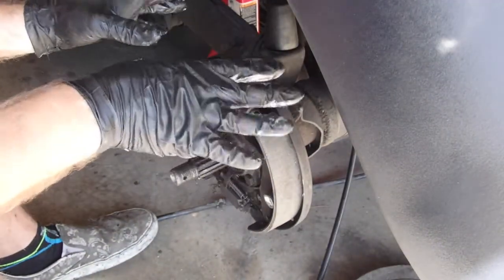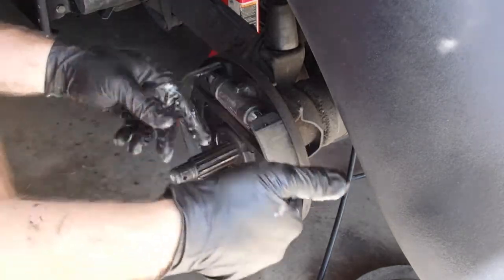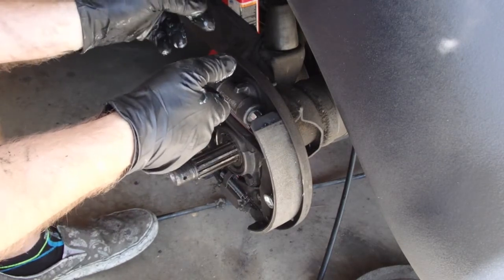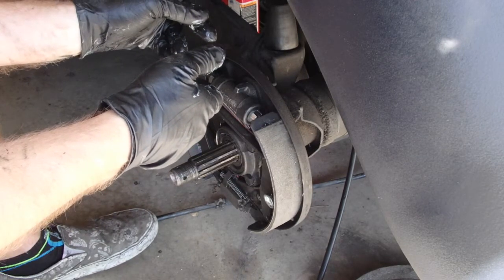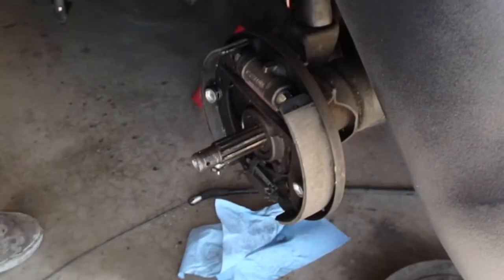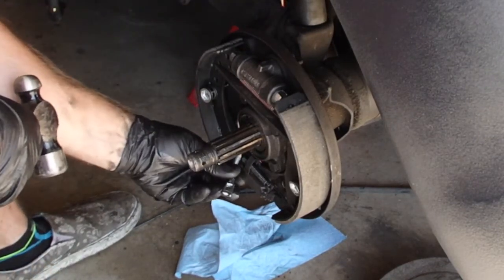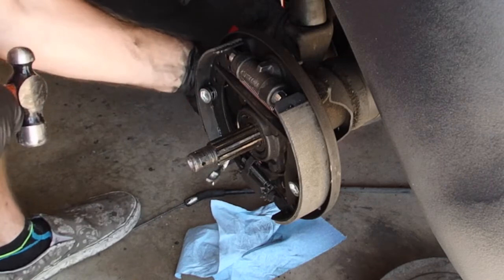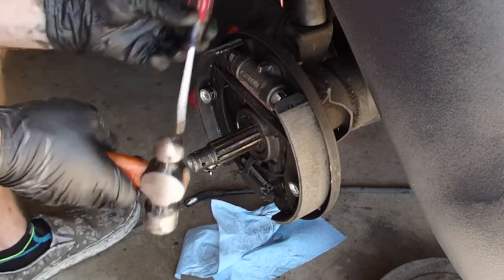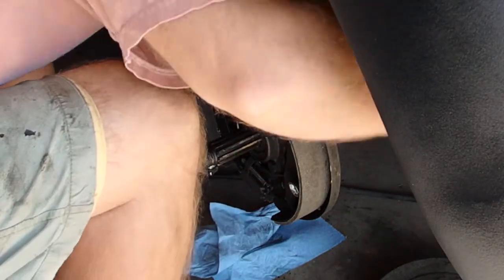You do not want to shove it all the way in and then hook it up here. If you do that, the end that attaches to the parking brake slides underneath the parking brake and actually goes closer to the shifter base, which you don't want. You need to be able to access it. So I'm going to go and do that. Okay, I fed the cable up to the handbrake. Now I'm ready to pull this in. And to get this cable sleeve behind to seat, just a screwdriver, hammer, light touches, and it goes in.